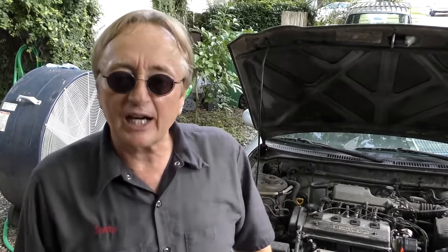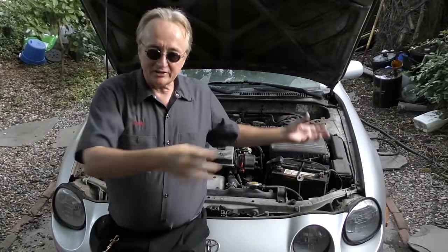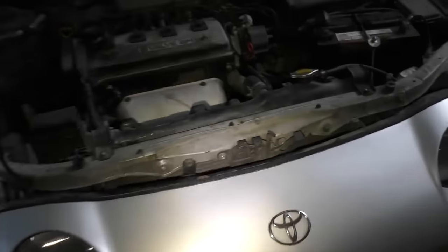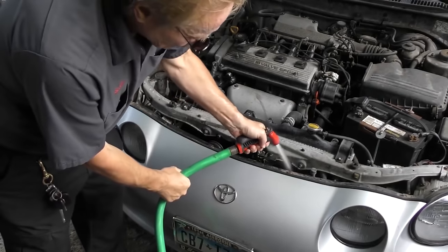Check your cooling fans every once in a while if you've got an older car. Also make sure your cooling system works right in conjunction with the AC. The AC condenser sits in front of the radiator — it looks like a radiator but it's the AC condenser. If those fins get any bugs or goop on them, you want to make sure they're clean. You can easily hose them off with a garden hose to remove baked-on dead bugs which restrict airflow to the condenser and the radiator behind it.